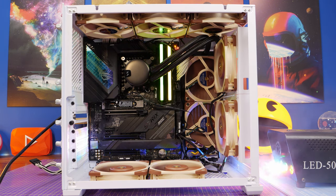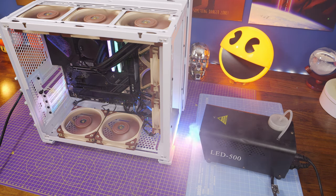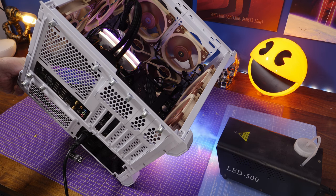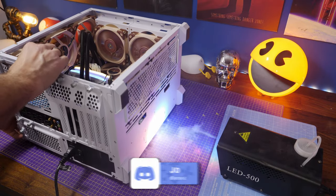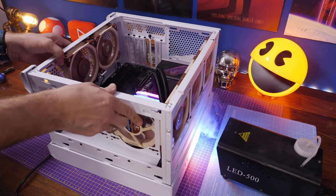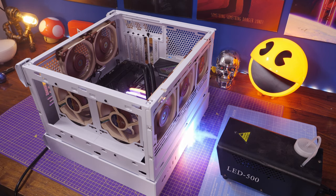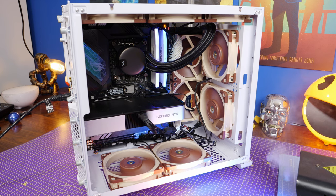If I set the smoke machine up at the front of the case and try to blow air into it — imagine this is cold air trying to go into your case — you can see the front fans are blowing that cold air away from the machine, and the bottom fans are doing the same, so rather than sucking cold air in it's being blown away, which is obviously not ideal. Once the GPU is mounted, there's basically no cold air blowing onto it from below or from the front, which is a problem because most GPUs operate with their fans below pulling air onto them and exhausting it out the rear where the connectivity ports are.